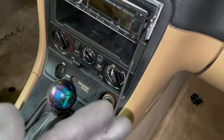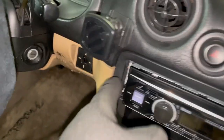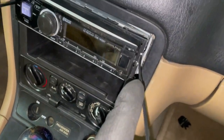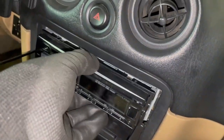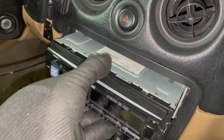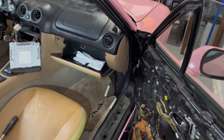It's so funny — I literally used a couple of snipped-off zip ties to stick them in here instead of the proper Ford radio remover tool. I just stuffed them in there until I felt the little pins release and it's actually enough to slide the radio out. That's so freaking funny.